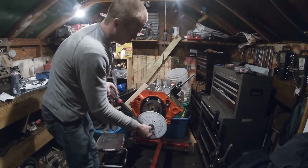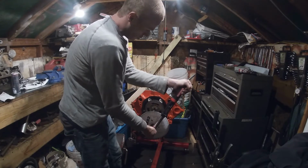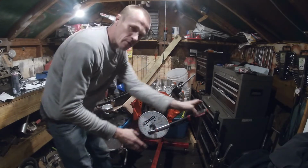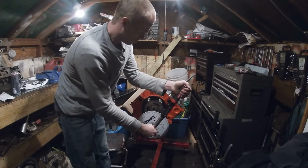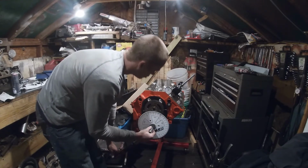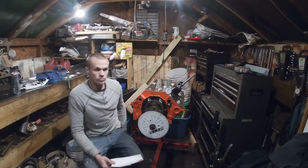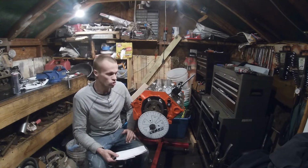Okay, now it's starting. There's 100 thousandths, 200, 300. We got a little over 328 thousandths, which is close enough. Now, we're going to spin it all the way back around again. Get back on the base circle. Still a 0. Now basically I'm going to show you how to do the intake. You can do the exact same thing for the exhaust.